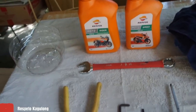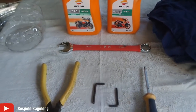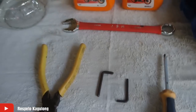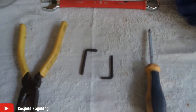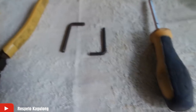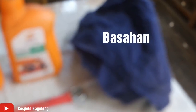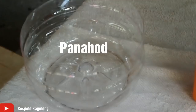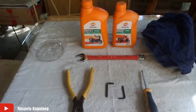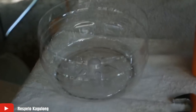But if you're a beginner and you think you need to remove the fairings to avoid spilling oil on them, here are the tools needed. You only need to remove the left side. You'll need a 4mm and 5mm Allen wrench, and definitely a screwdriver. Of course, prepare a rag and an oil catch pan. Recap: 1.2 liters of oil, 24mm socket wrench, plier, 4mm and 5mm Allen wrench, screwdriver, rag, and catch pan.